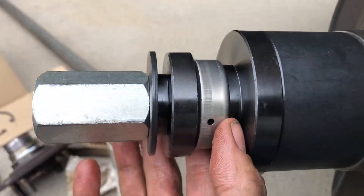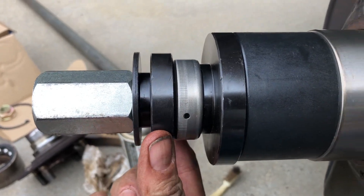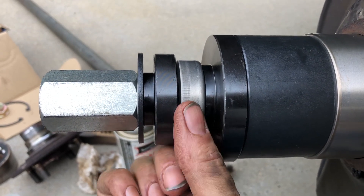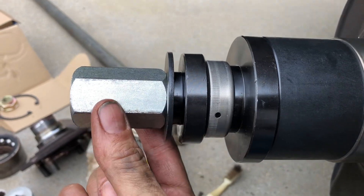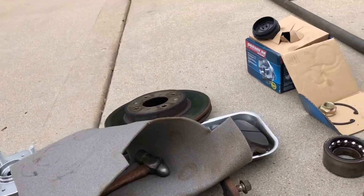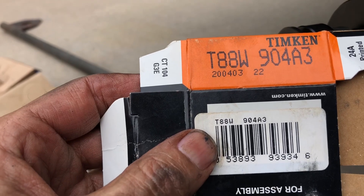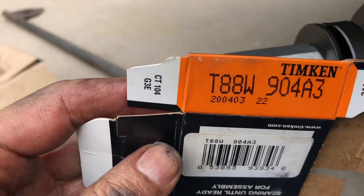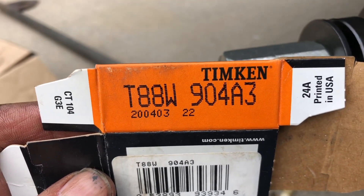This is what pushes on that. Now I've got my thrust bearing in there — I found this seemed to really help. The thrust bearing survived pretty well. I put this in here to provide a nice flat surface for the thrust bearing, and then I just have a washer and then there's the nut. By the way, I did order a new thrust bearing this time around — I ended up getting this Timken thrust bearing. It seems like it's working really well, maybe better than the original one. So if you have a problem with the bearing that comes with it, this one seems to be working pretty well.